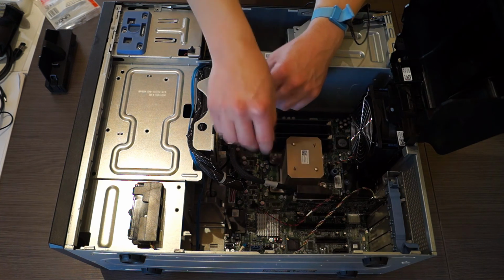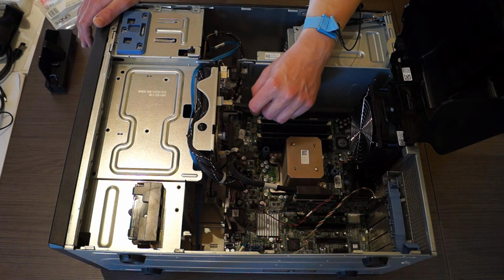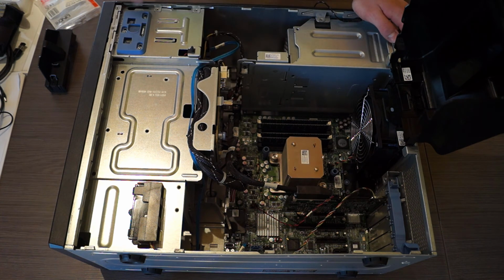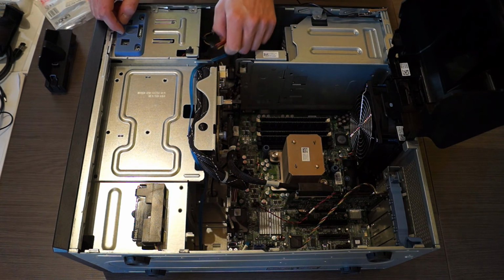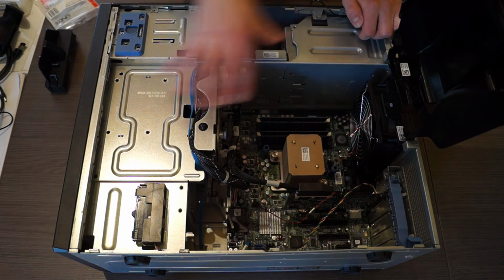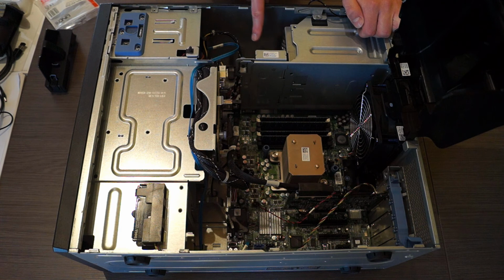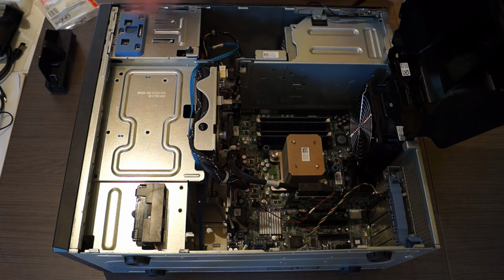And on this side another thing, I don't know if there's a standard for that. But we can put in every other controller over here. Here we got the power for the backplane, and here we got a DVD drive, and we have space for another thing. Yes, everything is well packed here, no cabling which is flipping around, everything easy. And here on the top side there's a little backplane for the 2 power supplies, and they're going together and provide all the power with one cabling into 2 power supplies.